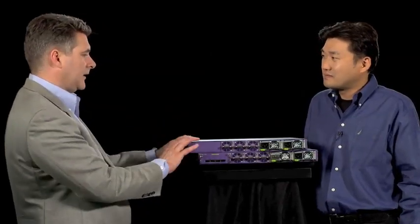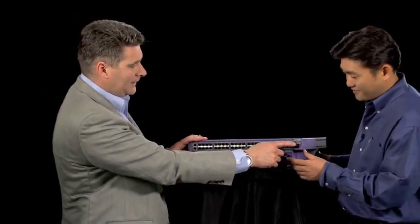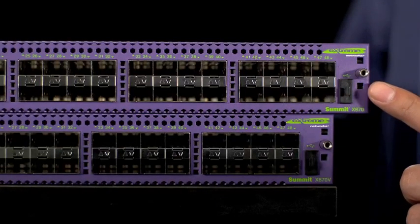There's one other thing — this thing called a motion sensor. Those two little holes there — walk me through what that is. This is a very unique feature set built into both Summit 670 switches. It has a motion sensor detection system built in, which will detect any moving object in front of the switch. This can be used for security purposes — if you're making the data center very secured, you can detect people moving around and it will alert your SNMP manager or syslog servers so you can take action. Additionally, the motion sensor can be used to shut off the LEDs to save power and improve security by hiding that the switch is actively working.